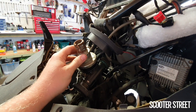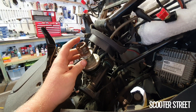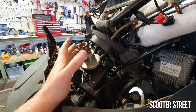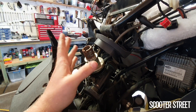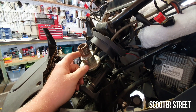So if you've noticed on your scooter the steering is a little bit notchy, which typically happens in the centre. You might notice that as you go to enter a corner or you're trying to drive in a straight line, the steering feels a little bit funny in the centre, like there's a big notch in it. The steering always wants to centre itself. Generally speaking, this is because you've got worn out steering race bearings.